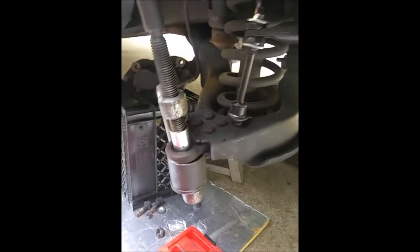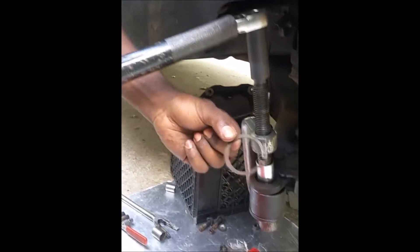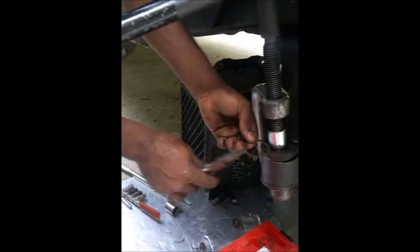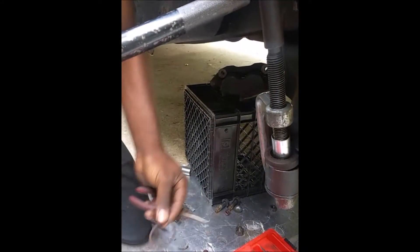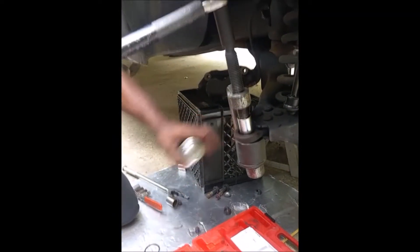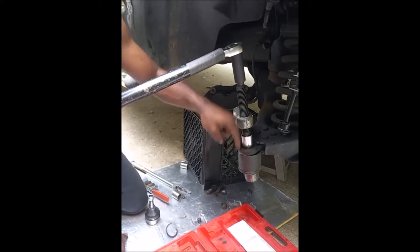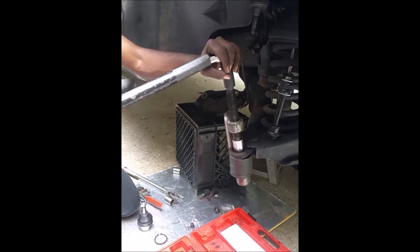On this 2003 Dodge Ram we had to take off the lock ring first. Just use a small flathead and needle nose to get it off. We're not going to need it because the new ball joint going in doesn't use a lock ring at all. So don't be discouraged by the lock ring on top or the little lip it leaves behind — the ball joint will slide right into the hole in your lower control arm.